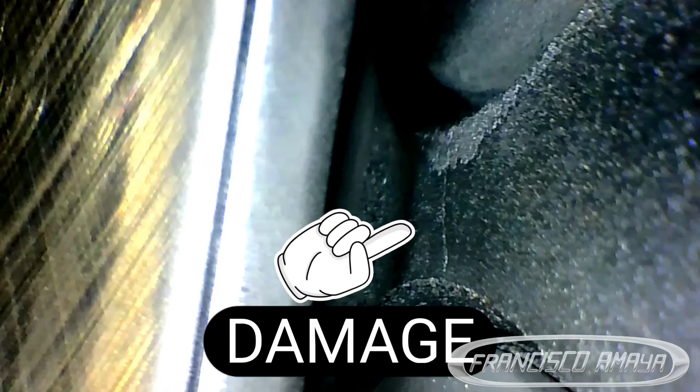These cracks are going to happen eventually over time. With Cummins X15s and ISX it's pretty common. There is no way to repair these cracks — the cylinder head is damaged and we cannot do any type of repair without removing it. The cylinder head has to be removed in order to fix this problem. This is a very common problem on Cummins ISX and X15 engines — it's pretty common and also a pretty expensive repair.